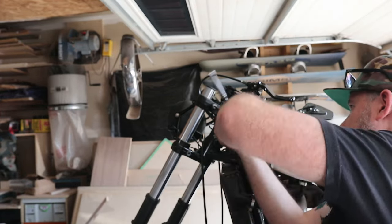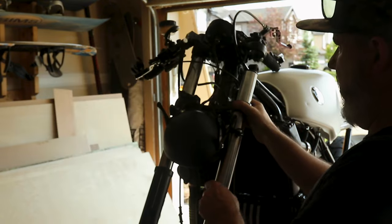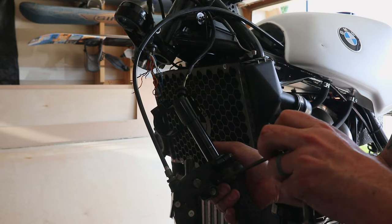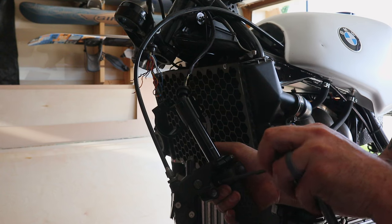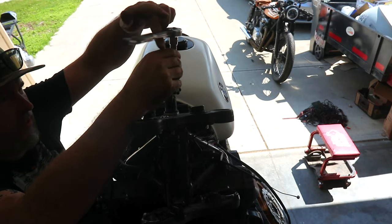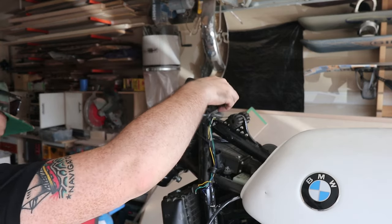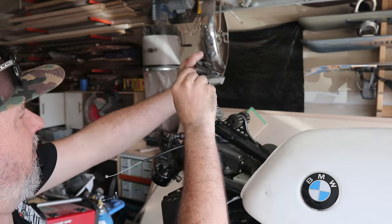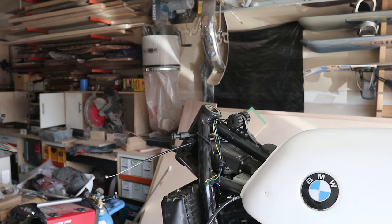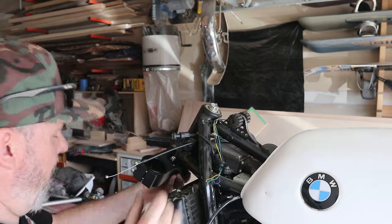When installing the brake discs with the wheel together, I moved on to removing the stock forks and triple tree. If you're doing this as an upgrade, I definitely suggest taking off all of your controls as well as your headlight all in one shot — I ended up doing it in different steps, which in retrospect I should have avoided. If you're building the bike from scratch you'll probably put it all together in one shot anyway. I'd also recommend taking the time to find the socket that actually works on that head bolt rather than using a giant crescent wrench. I'd also suggest replacing the bearings; the kit does come with new bearings.